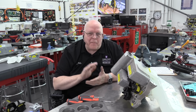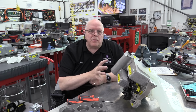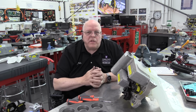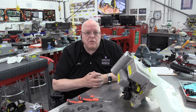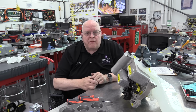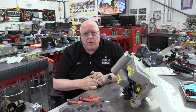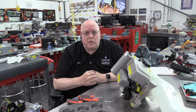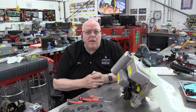All right, so wrapping up this video, it's been a long video. The big advantage to a heat pump system for cabin heating, if you live somewhere where you use cabin heating, is it only uses heat energy from the air conditioning compressor under most operating conditions. The Teslas I've driven that have heat pumps are very impressive in very cold weather, and I have no complaints at all with them. Only uses a small amount of electrical energy unless the temperatures are really, really cold. And in that case, then it uses existing parts to create heat rather than additional bolt-on parts like some other vehicle manufacturers have.